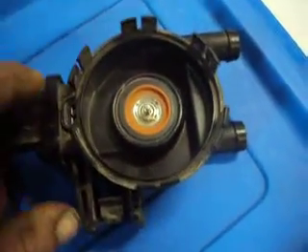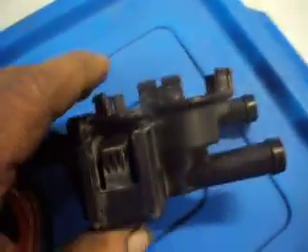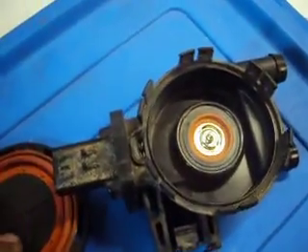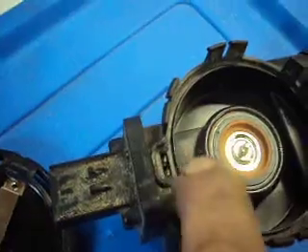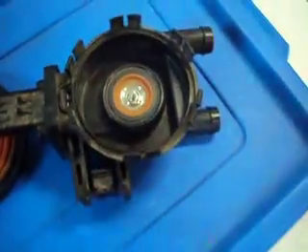That's about it for this video. Once you get it apart and take a look at it, it seems fairly simple, but for as simple as they are, they seem to have a lot of problems and the replacement rate is pretty high. The two major failures are leaks in the diaphragm, or just that little micro switch where the contacts go bad after a while, or you just get corrosion in there. Anywhere where you have an electrical problem, you'll get like a P0441 code or something like that.